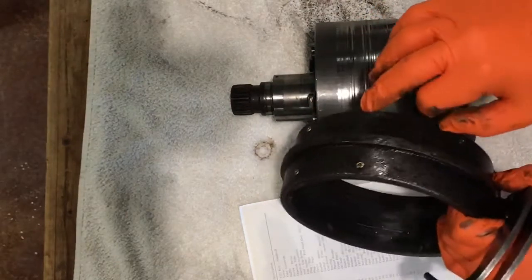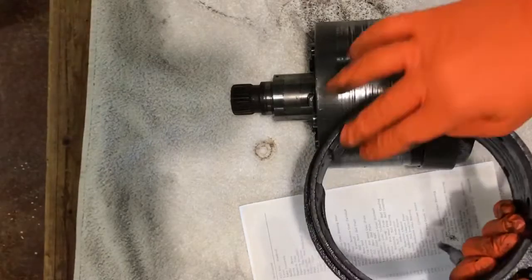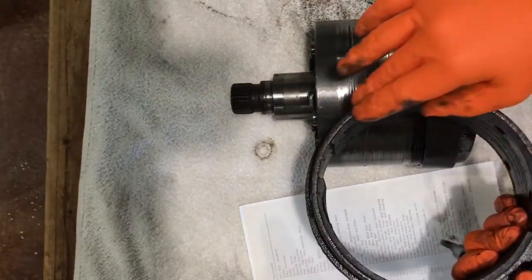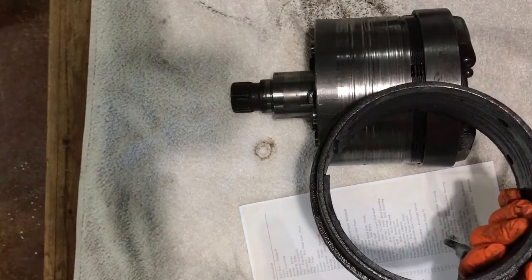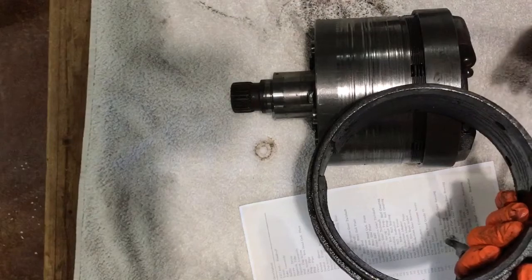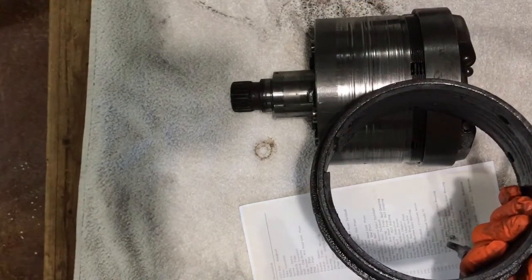According to Federal Marine, we might be able to get these rivets drilled out and get a new liner. The new modern way of replacing this liner is to take a replacement liner to a brake shop where they use a special adhesive or glue to bond the liner back on — it's good as new.